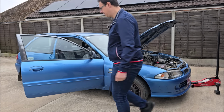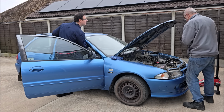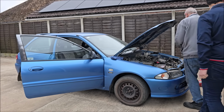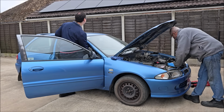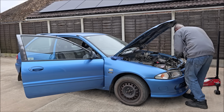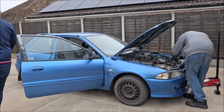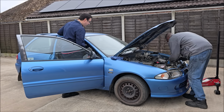Ready? This one. All right, mate. That one's 200 as well. Oh, good. Cylinder 2 was 125. All right, mate. That's 190. Oh, we're coming right up then. Yeah, they're all coming up. This is the problematic one. It is, mate. Cylinder 1 was 75, but we did put the oil in the bore. Hopefully that's burnt off. It came up to 150.